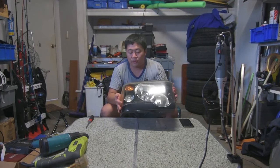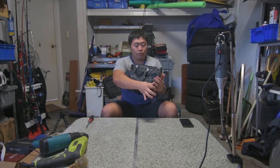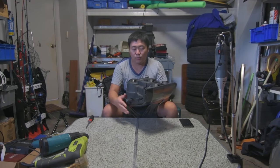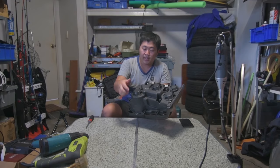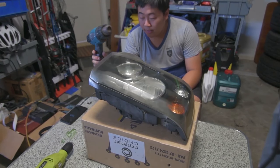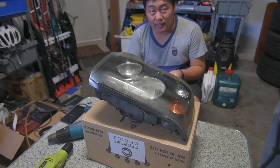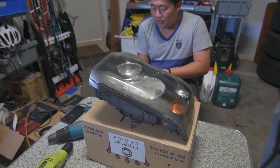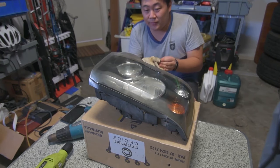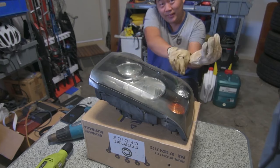To get the lens off, you're going to have to remove a couple of things. I'm going to remove the bottom trim — the finisher. There are two screws, one here and one on the corner. We also want to remove the light bulbs out of the housings. There are two ways of doing this: you can use a heat gun like I am, or you can put it in the oven at 200 degrees for 10-15 minutes. I'm going to use the heat gun method, so I'm going to be wearing gloves because it's going to get really hot.